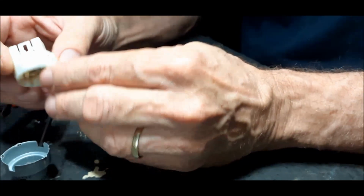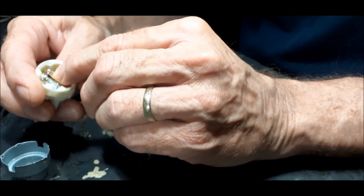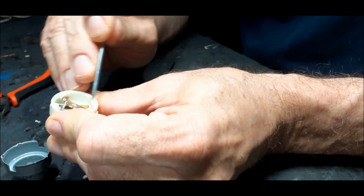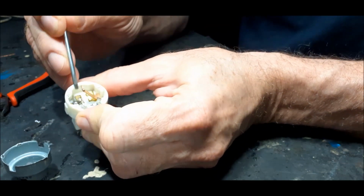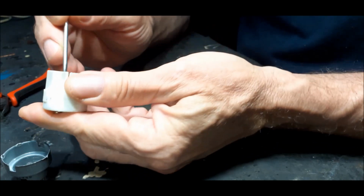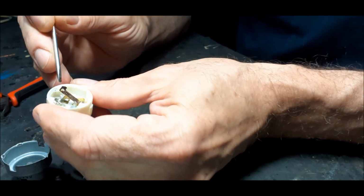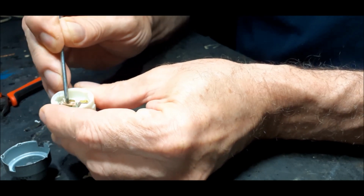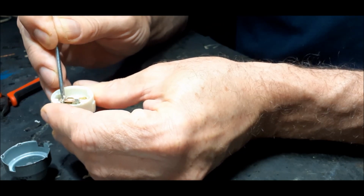Obviously these pins here just feed the coil on the top there, and here's the contact inside there. This is the one that normally burns. You can see the black inside there. Then it stops working. You can see that the brass pins are the contact, and the other two, I think normally it pulls and then it opens, and when it relaxes, it's normally closed.